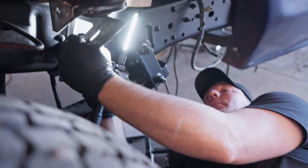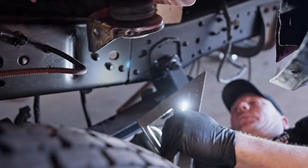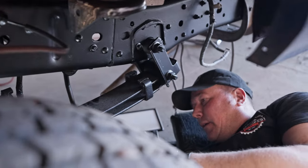I'm trying to find two points I can measure from the frame over to the body to make sure I'm square. That's really close to four inches. The other side says basically three and a half, so I need to go driver's side a quarter of an inch. I'm going to loosen up the rear mounts so hopefully the cab will slide over — that's all I need, just a quarter of an inch.